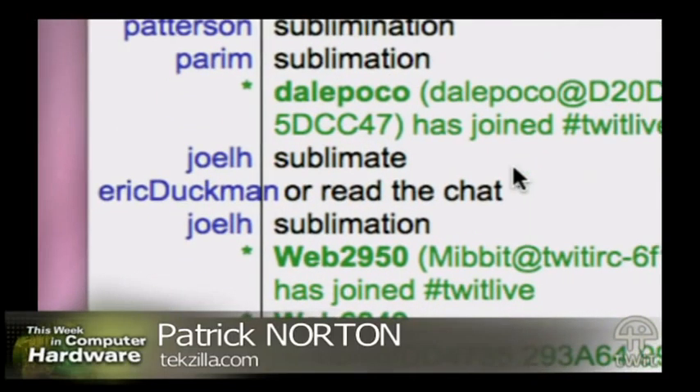I had basically a glove on and a piece of dry ice in my hand — a welding glove — and molded it until it fit the processor. It does whatever you call that change from solid to gaseous. Sublimation — thank you. With the CO2, which is like negative 109 degrees, the dry ice directly on there prevented it from booting. But it wasn't permanently destroyed — once it warms back up, it's all fine.